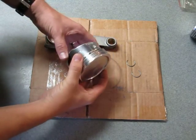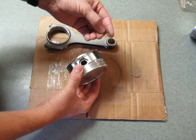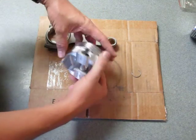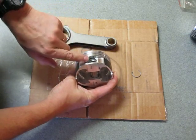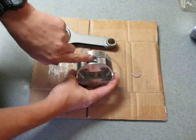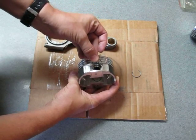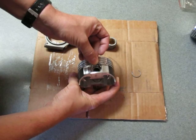What I wanted to do today was go over how to install these C-clip type pin locks in these pistons. This only works if you have a design of piston where the pinhole comes all the way to the outer edge like this. We're going to use that part of the piston for leverage when installing these locks. The bottom of the lock — the open part — will end up being straight down.